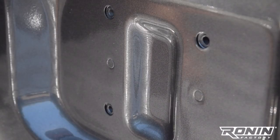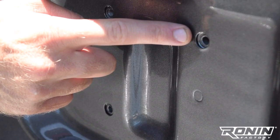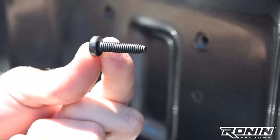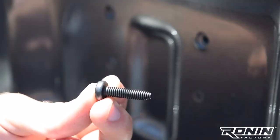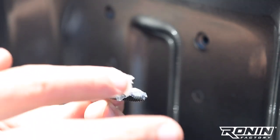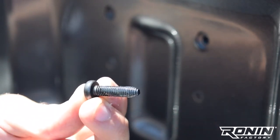There are some tips to help ensure a successful install that I'll cover now. First, you'll notice that the bolt holes in the truck for attaching the brackets are not threaded. Our screws are made to be self-threading, which requires some forethought before you jump in. Second, you will want to add a lubricant to the threads of the screws. This will help reduce the friction when screwing in and prevent the bolts from breaking.